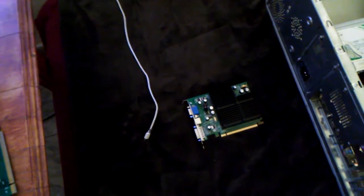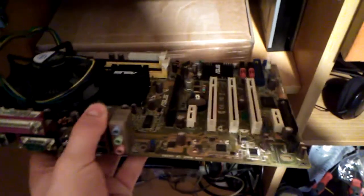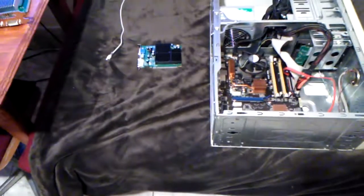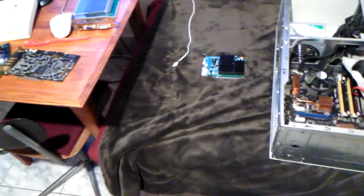So maybe there's something with the motherboard, but you know, today I already replaced the cooler, and now I should remove the motherboard and find another one. There is this old motherboard, but I don't know if it's capable of doing anything actually. I mean, it's working, just at low memory clocks. I'm not sure that the Q6600 can work in it. Maybe it can, so I'll try someday. Maybe I will try the Pentium 4 now, and that is a part of a different project. So I will still share the results of this little benchmarking with these three graphics cards.